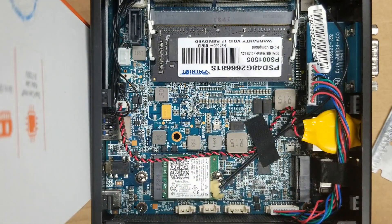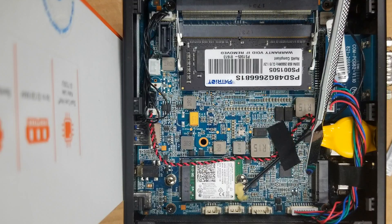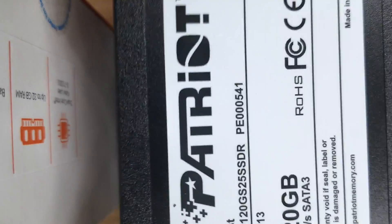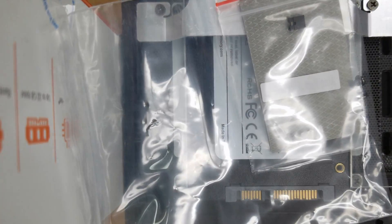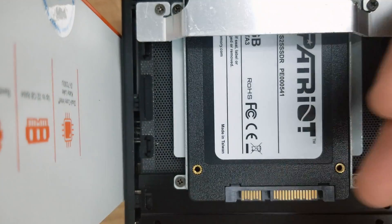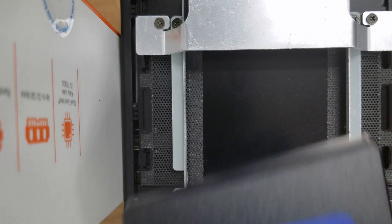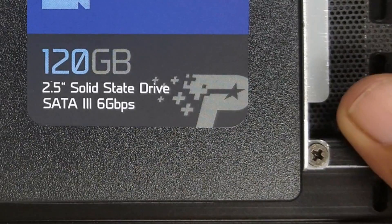Try to be careful not to snap the RAM or damage the ports when installing. Here we see the M.2 slot, which is also compatible with PCIe. Today we're going to concentrate on this port where we'll connect the hard drive with the SATA cable. Very important — don't put the hard drive in backwards, otherwise the screws in this bag aren't going to fit in the holes properly. Make sure it's in there correctly with the ports facing out. Then take the screws from the bag and secure the hard drive to the bottom case.